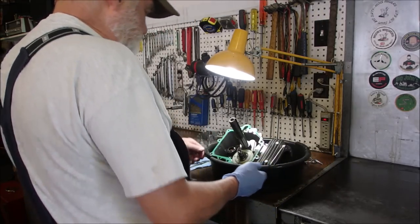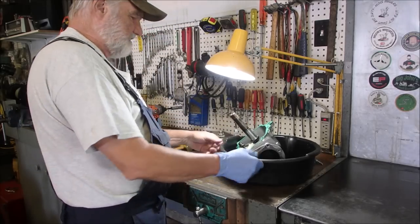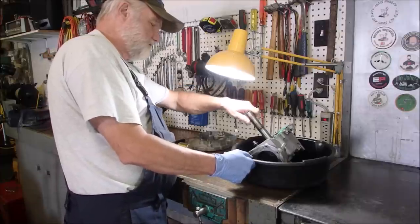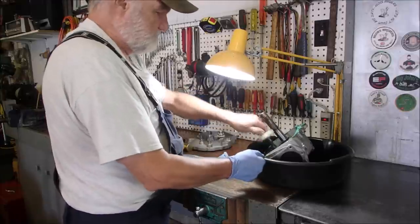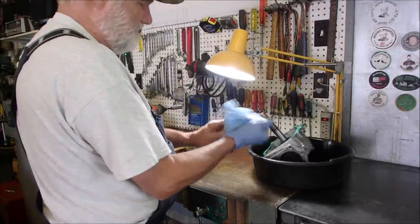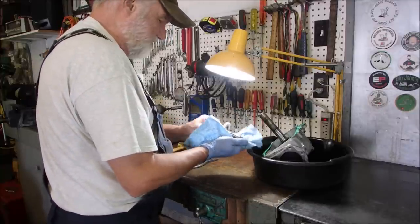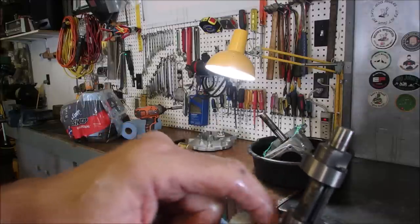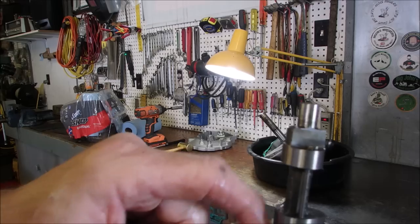Now, there should be a timing mark. I tell you, this thing's almost exactly like an old Tecumseh. Wayne was right. Oh, it even jumped the, there it is. Oh, no way. I'm gonna look this up to see if this is the right part. This little cam opens the exhaust valve right there, and then when the engine speeds up, it goes off to the side.